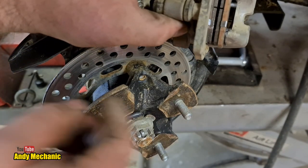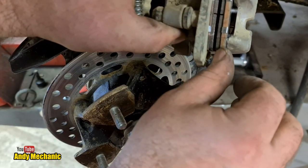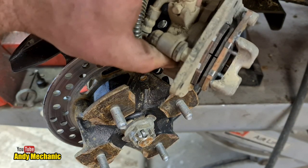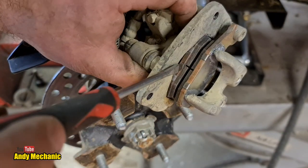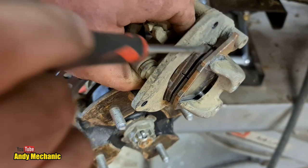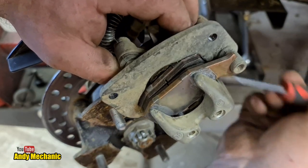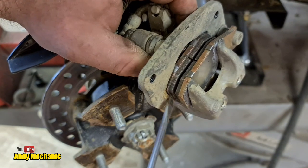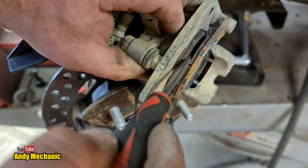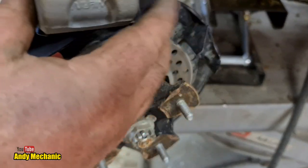As you can see, there's not that much of a gap between the pads. So we'll get a flat screwdriver and give it a little jiggle - it'll push that pad just a bit further out and then it's ready to go back on the bike. Make sure that inner pad's all the way in as well. Back on the disc. Lovely jubbly.